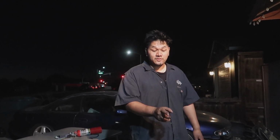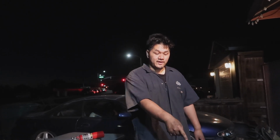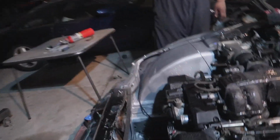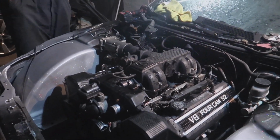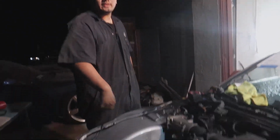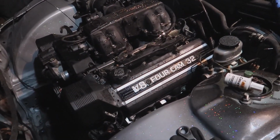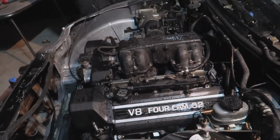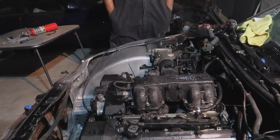And if that's the starter wire, we'll update you guys on what it is. It's getting 12 volts when we crank it, and that's what's starting the fire. Other than the leaking gas, that's the source of our spark. So that's one of the things we can double check first before we try to start it again. So I guess we'll take all this off. It's good, you can repaint it. Yeah, I wanted to repaint it anyway, and some of the paint got damaged too.